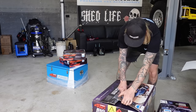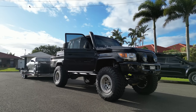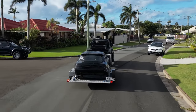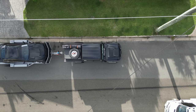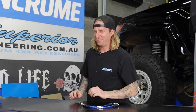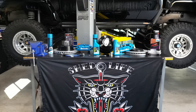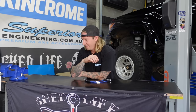Why am I upgrading the brake? Gonna be doing heaps of towing this year — thinking about maybe a camper for the family, but definitely towing the drift car. The drift car's got a lot of weight. It does have electric brakes, and most new trailers have electric brakes. Electric brakes can fail — if you've got a dodgy plug or anything like that, you're back to your car brake. That's why you want to upgrade your brake. And wait until you see these things — this is not just your normal brake upgrade. This is a six-pot race upgrade. Things should stop like a bloody GTR.